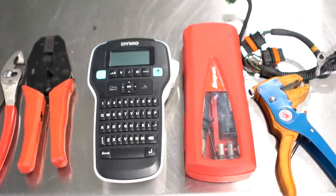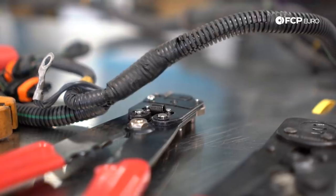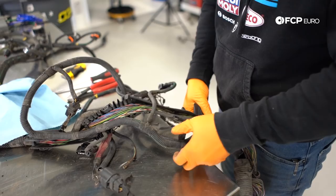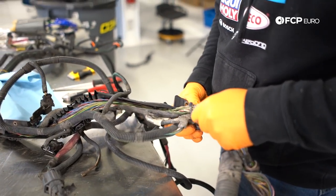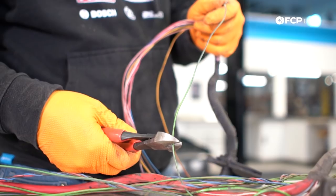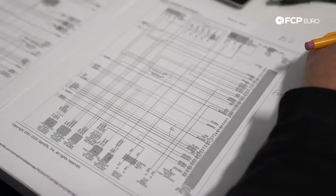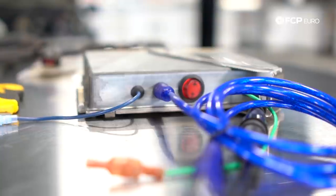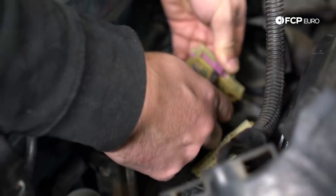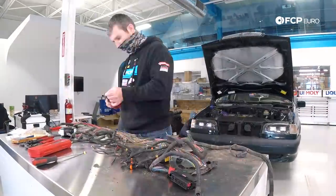The most challenging part of this swap is the wiring for the engine management. The main reason is that we're starting with an LH 3.2 car. Bosch Jetronic LH 3.2 was an antiquated engine management system found on early non-turbo Volvo 850s — it used a completely separate ECU to control the ignition and a separate ECU to control the fuel. In order to tune and get the most out of our built RN engine, we're converting to the updated Motronic system, which uses one ECU to control both ignition and fuel. Aaron from Vast Tuning sent us a modified M4.4 ECU that retains both variable valve timing and direct ignition coils. Normally this ECU would be plug and play, but because we have an LH 3.2 car, it wasn't going to be that simple.